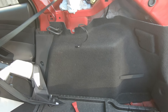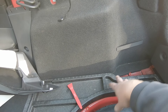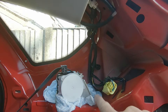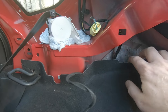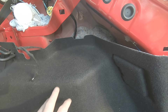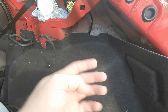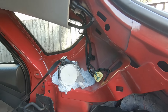What I had noticed was when you take it out for a drive after it's sat overnight, there'd be a few speckles of water on the top of the boot carpet in both corners. As we can see here, there's still a drip coming down from this cable, dripping down onto the area that holds the seat belt, and from there it's been running down the side and soaking into this carpet sound deadening. This side was a little bit wet but not too badly. Long story short, I thought to myself — it can't be the boot vents anymore because I've sorted those out, they're freshly done.